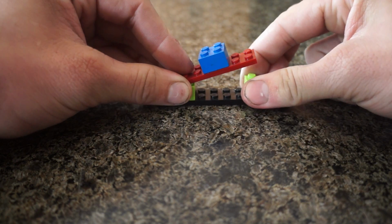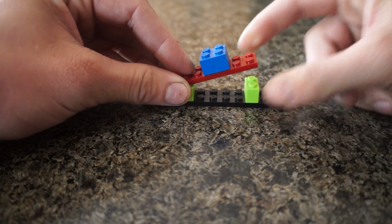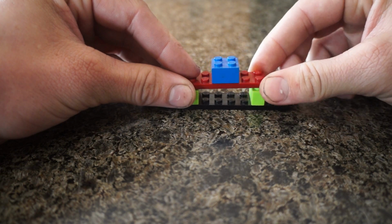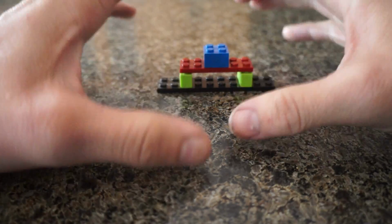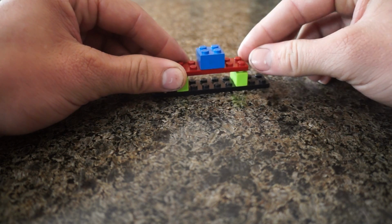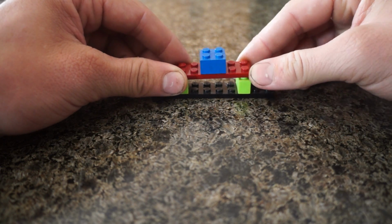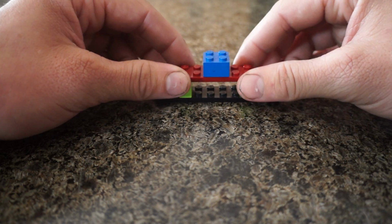So then we can take this engine mount all the way off, put the new one back on, and it makes it a little easier to align it all back up because it's pivoting off of that other mount. Now, of course, you're going to have transmission mounts back here that'll also help guide it, but it's still going to be kind of a trick. A couple times I've done this, the motor has dropped straight back onto the engine mount, no problem. Other times it'll still be off a little bit, so you have to jimmy with it and mess with it to get it aligned properly.